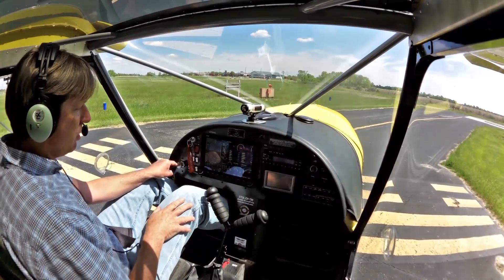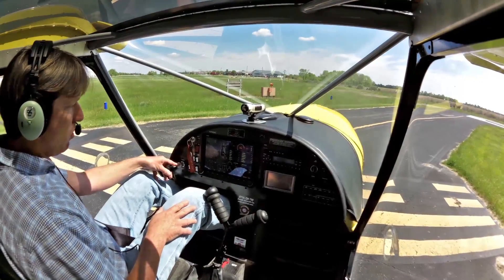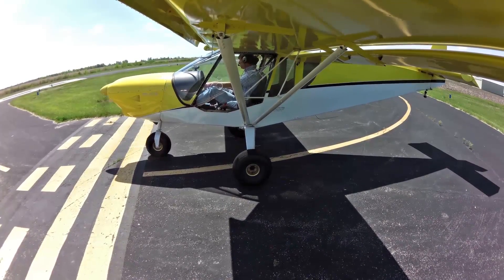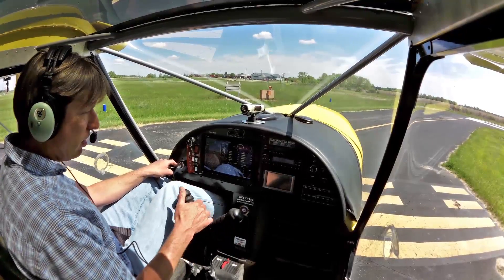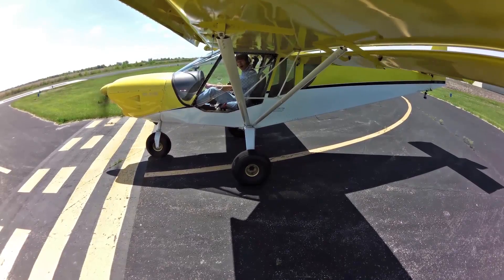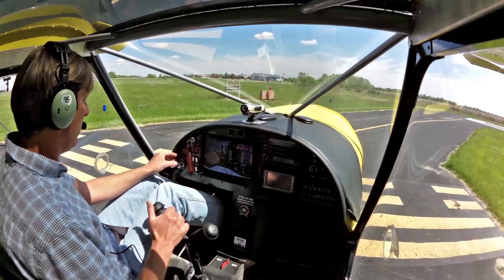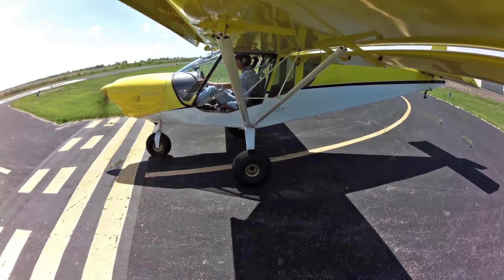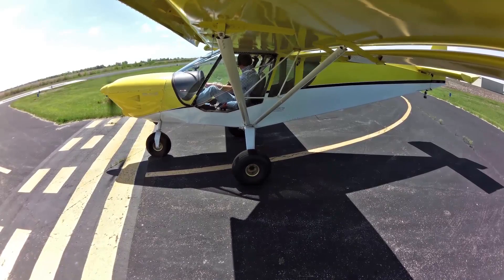I get a lot of questions about the brakes. We're going to run it up and see how well the brakes are holding. I'm at 2200 RPM right now — almost 2300. They're going to hold for what you need in this aircraft. Then we're going to check our control deflections — everything's going the proper direction, full travel. Then we're going to lower the flaps all the way, check our deflection again and control input. Then we bring our flaps all the way up. For takeoff I like to use about half flaps — so we're going to go down about halfway. Full flaps are 15 degrees and half would be about seven, seven and a half degrees.